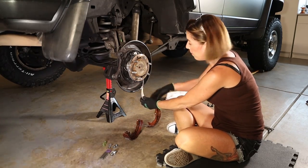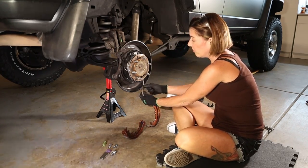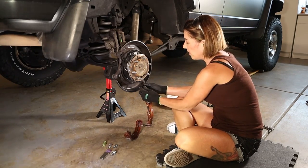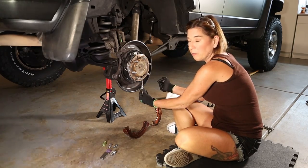After that, go ahead and attach the parking brake arm to the cable. This is kind of spring-loaded — it doesn't just slip through, so you're going to have to bend it up, put it on, and then it'll spring back into place.